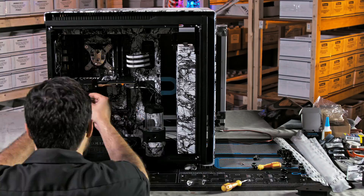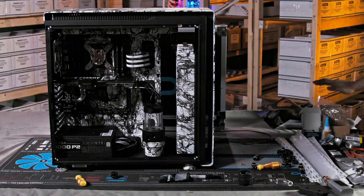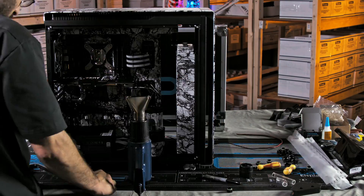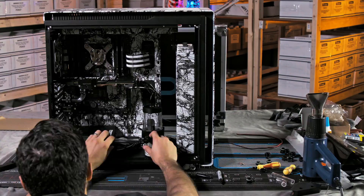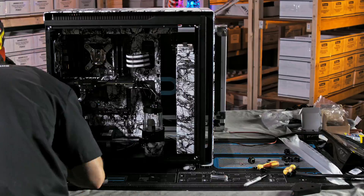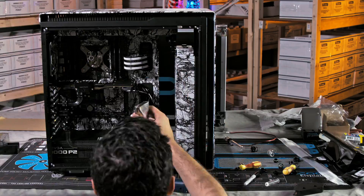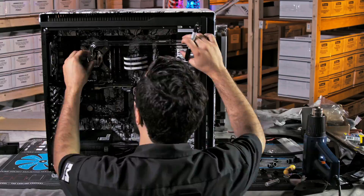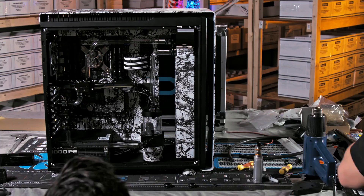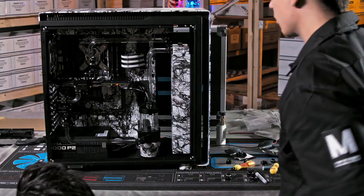The tubing was a bit of a pain because I'm a perfectionist — as most people are with hard tube. You always want to get that bend perfect, and sometimes you think the first bend is good, then you get to the third tube and realize the first one is now crooked. What you see here is us figuring out where the tube's going to go, how it's going to look — maybe it didn't bend correctly, we cut it too short. It's just a trial and error process with hard tube. The 16mm by 12mm tube we used actually takes quite a lot of time to heat up and get malleable enough for a nice fluid bend. I've used 12mm by 10mm tubing before and that bends a lot quicker and easier, so if it's your first hard tube build, just go with the 12mm.